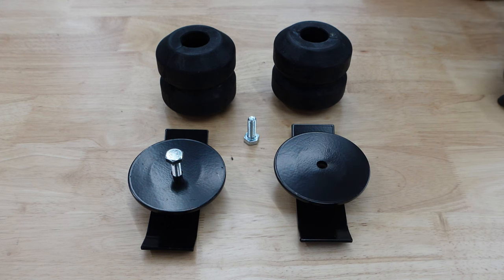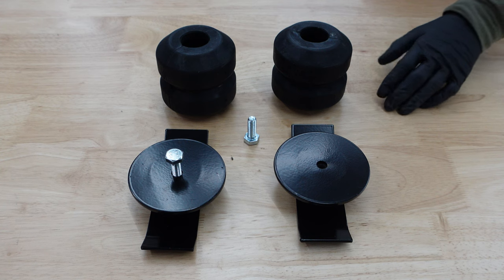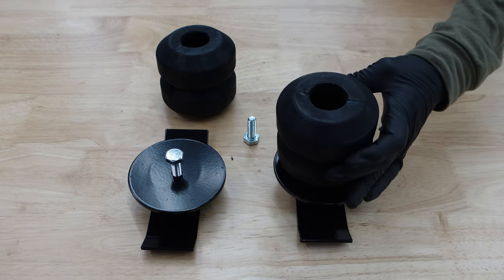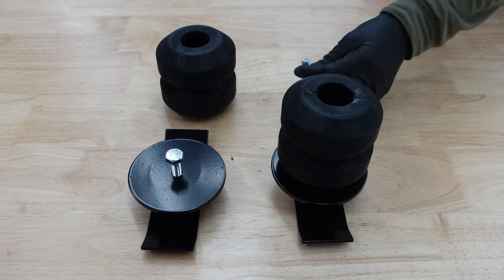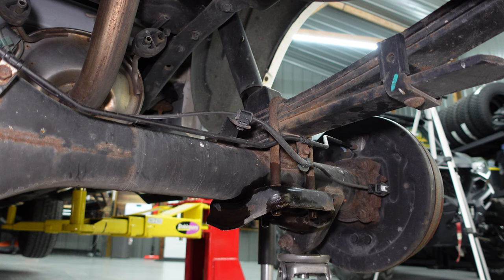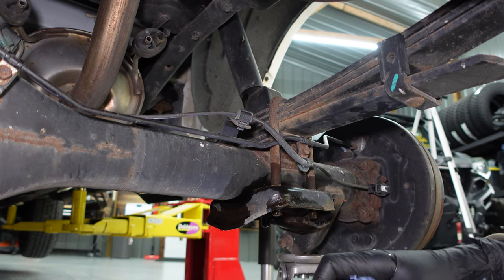What comes in the kit is the mounting brackets, the actual bump stop replacement — the actual SES — and that mounts on top of the mounting bracket. On the other one there's a bolt that will slide through and thread in all the way at the bottom. The U-brackets from your stock Tacoma bump stop will be reused unless you have to replace them due to rust. We're using the floor jack here so we can get it on the lift but still hold the axle in place.